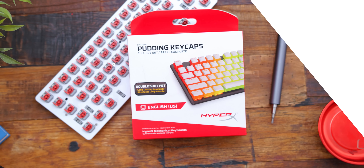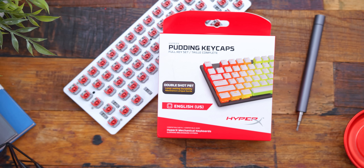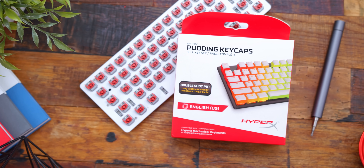One of the more common questions I saw in the review is whether people can use their own keycap set on this to customize it — mainly the pudding keycaps. Since the switch doesn't look like a traditional stem, people don't know if it's compatible. But yes, since we do have that cherry-style stem in the middle, you can use whatever keycaps you want — GMK, PBT, ABS, DSA, SA, XDA, and more. We not only have a standard bottom row on the Mini, but the optical switches still have that cross stem for mounting the caps.